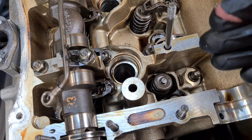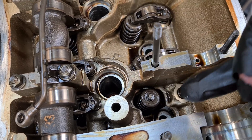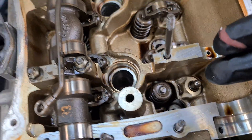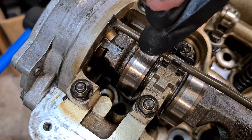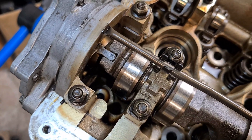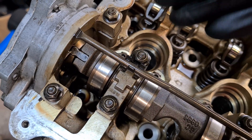But that's not because the piston is in top dead center position — the valve still has to be all the way up for you to be able to install the keepers back onto the stem. Keep that in mind, and also at the back of the engine there's very little space to work. It's much easier if you have compressed air applied to the cylinder, as that stabilizes all the valves in place and you can get the job done faster and easier.